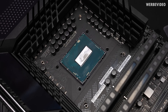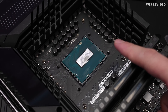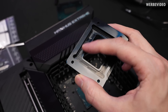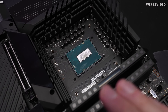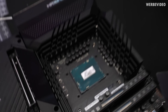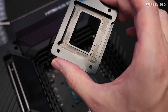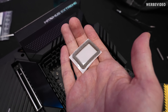The CPU is ready, cleaned, and already back in the socket. The next step is mounting the CPU the same way as we did with the contact frame but now with the direct die frame. If you look at the direct die frame you notice there is some kind of rectangular shape in the center — this shape will apply the appropriate force onto the CPU PCB to make sure it's correctly mounted in the socket. At the same time you have cutouts surrounding it, and these cutouts provide space for the SMD parts surrounding the CPU on the sides so these will not be shorted or receive any unnecessary pressure.